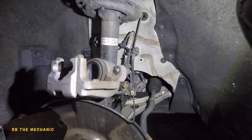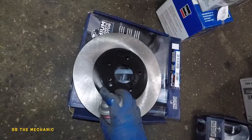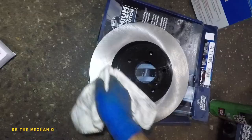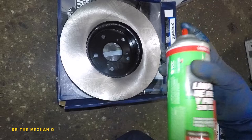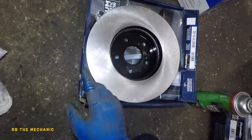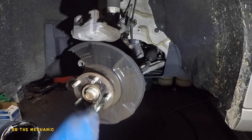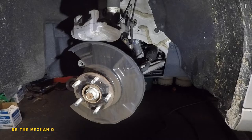Here's the brand and part number on the new rotor if you guys want to pick it up. We're gonna clean it off really well with a clean rag, wipe both sides. You are gonna see smoke and smell it within the first few miles, so drive gently — we'll talk about that on another video.